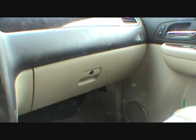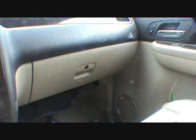Oh, and I was going to point out, right there, behind that kick panel, they got some wires run. I protected that because that's another no start issue. That guy spent 40 hours on that Denali trying to figure out why it wouldn't start. Well, I thought it was being stalled because the data link green wire's over there, and that rubs against that bracket and eventually rubs through. So I took a hose, slid it over that bracket, so now those wires there should not get broke. So that was another precaution I did to this thing.